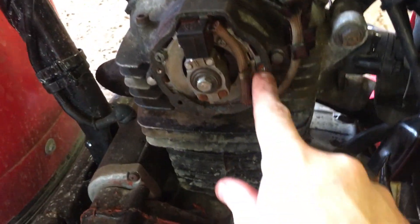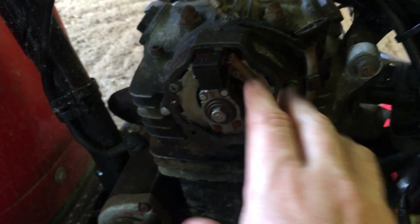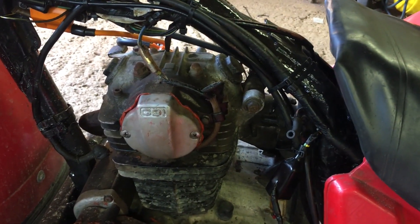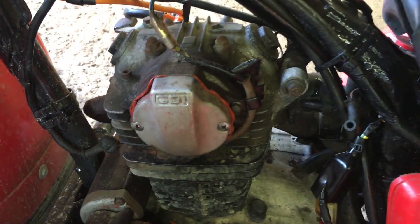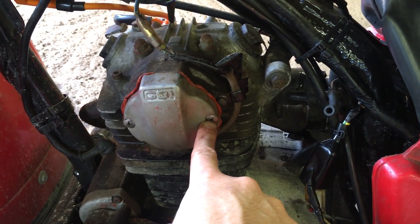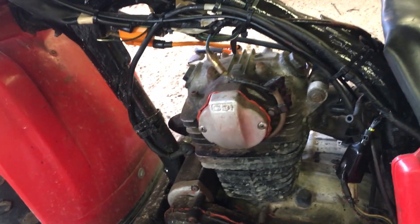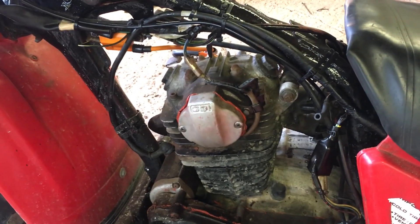I just finished tightening both screws — we're properly gapped and there's no excess play, as it should be. I'll put a little gasket maker around the edge — you don't have to, but I like to do it. Then the cover goes back on. That's it — that's how you set up the mechanical advancer and pulse generator. Try not to overtighten those little Phillips screws because it's very common to find them seized or stripped on these small engines. Hopefully this helped clarify some things. Thanks for watching, feel free to like or drop a comment below, and we'll see you next time.